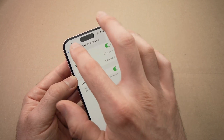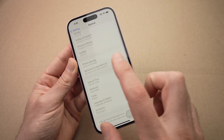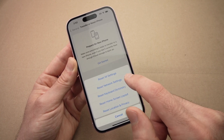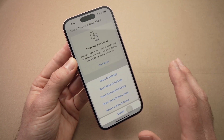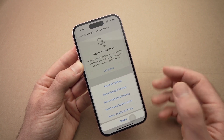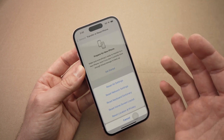I have two more solutions if nothing worked. Go into Settings, then General, then scroll down until you see Transfer or Reset iPhone. Tap Reset, then tap Reset Network Settings. This will not delete anything — it won't erase your pictures or accounts. It will just reset everything network-related, including your 5G and Wi-Fi networks. You'll need to reconnect to Wi-Fi after. Press Reset Network Settings, wait a few minutes, and then your phone will try to reconnect to your 5G network — hopefully it will work.